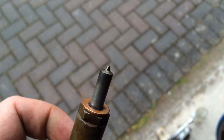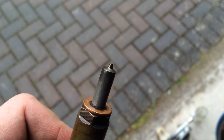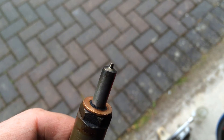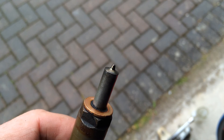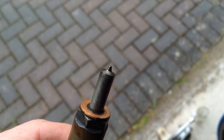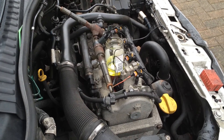From the video you'll see that the two injectors that I run both fire all five pinholes. They spray a really good mist — they spray, they don't squirt in a jet — and you hear a good popping sound as well when each one goes.